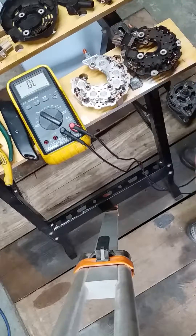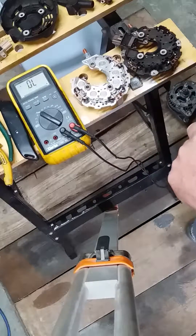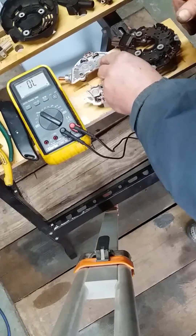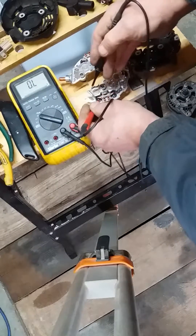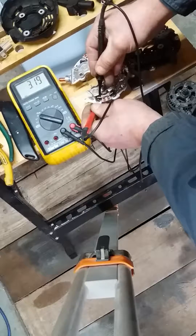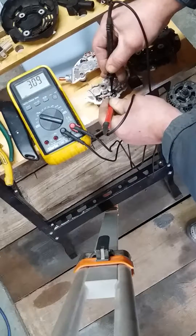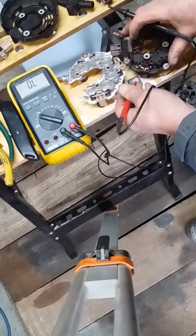That's the reading you would get if the unit was in situ inside the alternator case or fitted to the vehicle. But we'll have a look at testing the individual diodes, so we'll go back to an ohm setting. From ground to the top of the first diode is 3.19 meg, next one 3.09 meg - we'd get the same working our way around on the new unit. Now on the old unit: